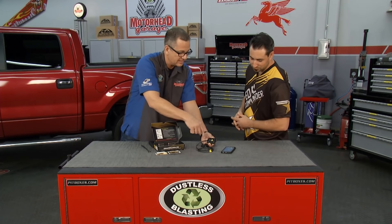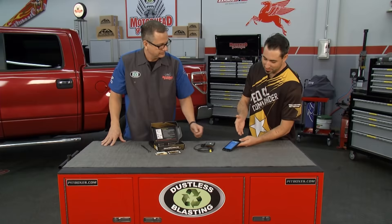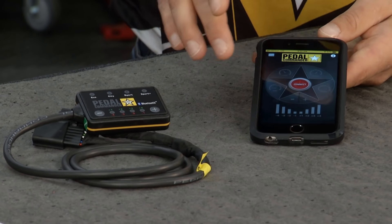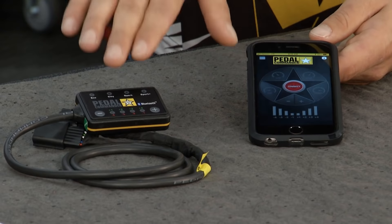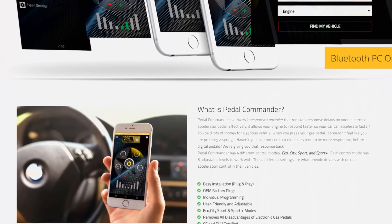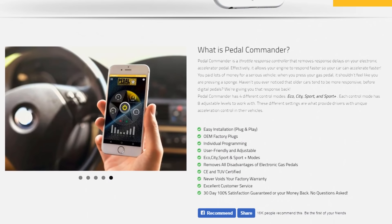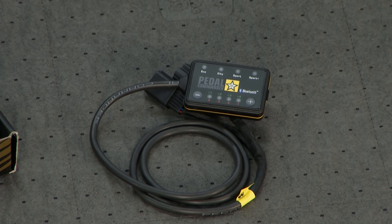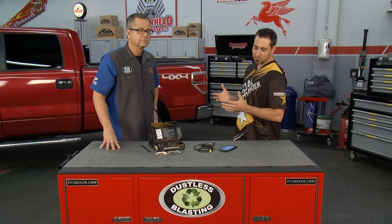I also see Bluetooth on there — I can actually communicate with it via my phone. We integrated a Bluetooth application so you can control everything right from your phone. It allows you to switch modes and increase or decrease throttle response. If you have teenagers and a nice car and you want to lock them out, you can use the phone app to close off the touch panel — they're stuck in Eco mode and can't go faster than 50 miles an hour. Manufacturers only open to about 86% to preserve the warranty up to 100,000 miles, but with Eco mode we keep throttle body closed to about 20%, and in Sport Plus we open it up all the way to 98%, giving you a lot of margin to work with and the driver experience to control your vehicle how you want.